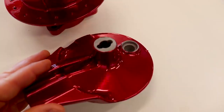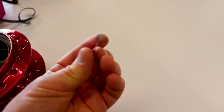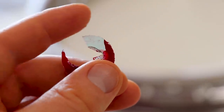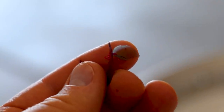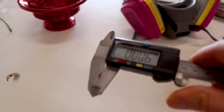So I'm peeling the masking tape off this rear brake panel, and I thought I'd show you guys just how thin the powder coat buildup actually is. I've got a piece of masking tape with the powder on it - this is two layers, the chrome and the red. Just look how thin that actually is. I'm going to measure it just for curiosity's sake. Wow, I didn't realize powder coat was actually that thin. That surprised me. Maybe I don't actually need to do that much masking.